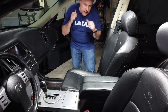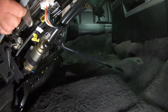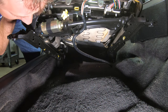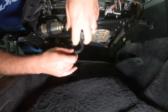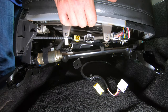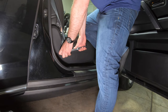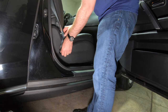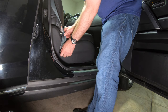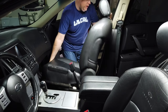Now it's time to try to get this seat out of the car. The power connector has a little clip that attaches it to the seat frame — you have to remove the power connector from the seat frame before it will come out. And the seat belt — I didn't even think about that — the seat belt is actually attached to the seat here. It uses the same size bolt as the others but it would be a lot easier to remove if you'd done it while the seat was still anchored. So I would recommend you remove this bolt first and then the seat bolts next.